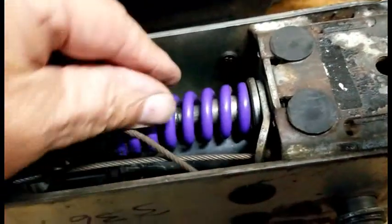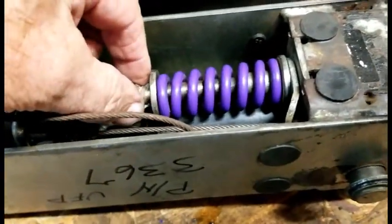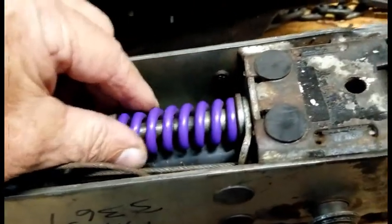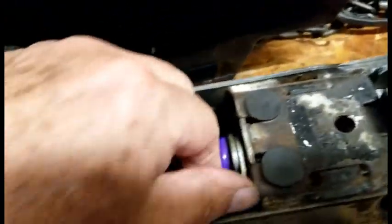This is an extra strong spring so that when you step on the brakes, you only push the brakes in so hard. If you push them in really hard, it'll lock the wheels up. This is feedback to the whole mechanism. This part here is the breakaway cable.